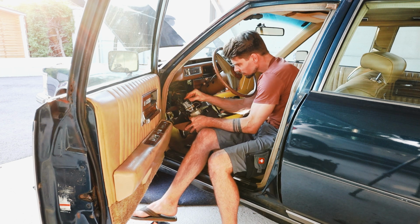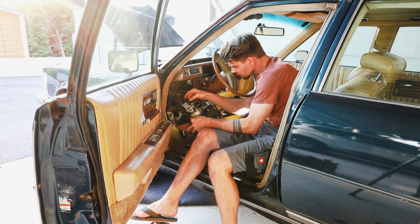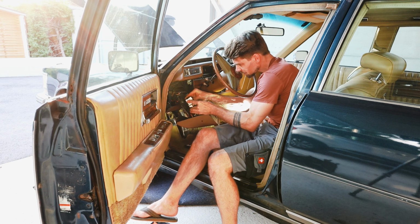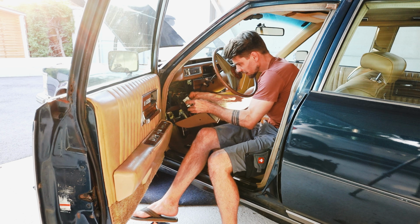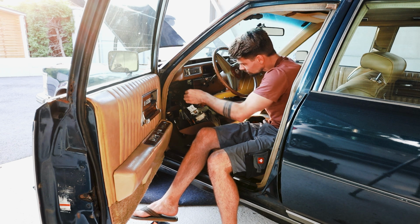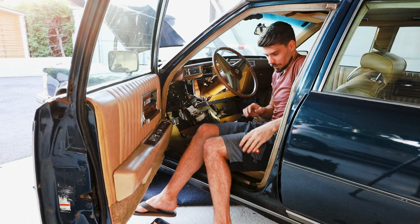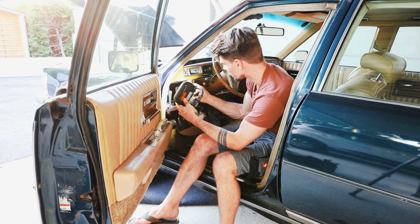And if you put in all these connectors here, be careful that those are really in. Because one time I pushed the connector back in and bent one of these blade connectors down there, and the headlight wouldn't switch on again. Let's reconnect the AC connectors. 1 and 2. There is another connector in here, and another thing I want to show you that highlights how much the previous owner butchered around in here.